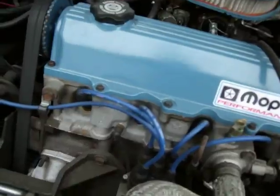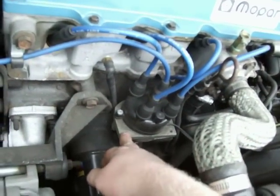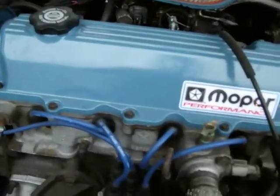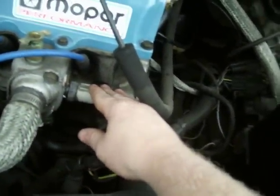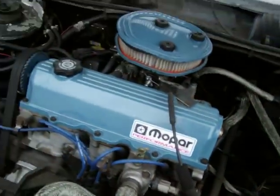Most carbureted older engines — especially V8s and Japanese four-cylinders — will have a vacuum advance or mechanical advance system in the distributor to change the timing, whereas these do not. Inside here is just a wheel with four little metal tabs that runs through the pickup coil to tell the computer to spark, because it has no points, no advance, nothing. That also means you cannot run a standalone MSD 6A box on this vehicle because you need the factory computer to control the timing curve. Also, if you ever have issues with the car running weird, the temp switch here has to be unplugged to set the timing, because that also changes the timing curve. It's kind of halfway between fuel-injected and carbureted when they designed this thing.